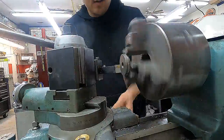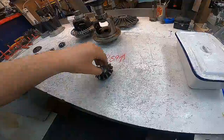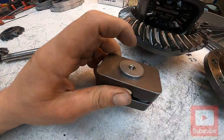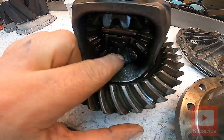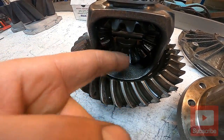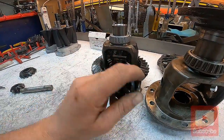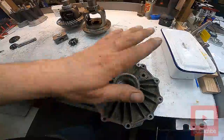Turned down perfect — now this will fit right down in there. All I've got to do now is take this one apart — the one that actually belongs in the car — and switch these spider gears out, because there is a lot of really bad pitting on them. That's pretty common. I've got another set of spider gears to swap in. Maybe tonight we'll have this all finally assembled and then we're just waiting on our new gaskets to come in.